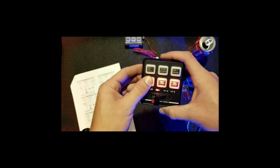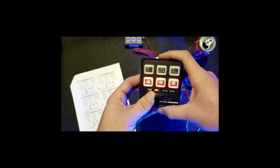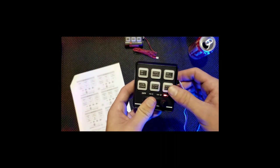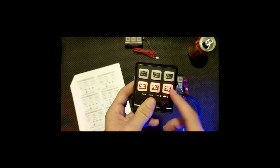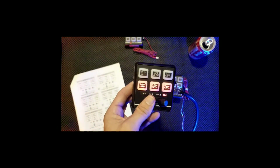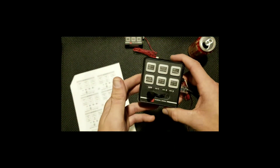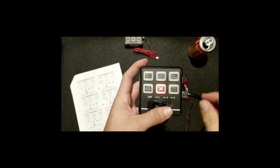This position corresponds to mode one — push that button and it changes your mode one flash pattern. When done, move to mode two and push that button to cycle through mode two patterns. Same for mode three. When pressing the button, let the pattern run for a second or two, then press again to cycle. You have 15 seconds total before the timer runs out. If it times out and you didn't get the right pattern, just hold the bottom three buttons and go back to that mode. Once satisfied, unplug and plug back in — you're locked in.